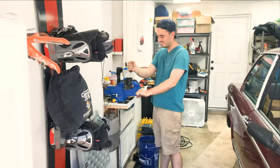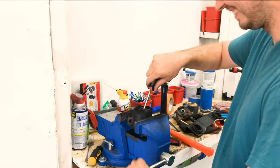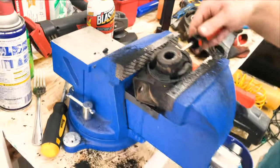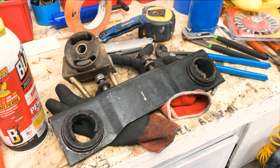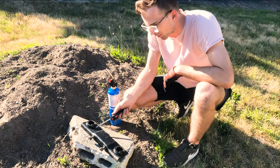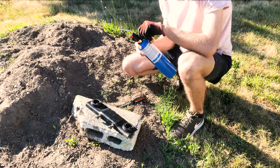It's rubber from 72. First gear, second gear, third gear — it's still probably more tight than my shifter. Let's torch it. You think torching is not going to smell bad? A little bit, but different. A portion of the bushing is out. Now we're going to try heating up the metal around it to see if it'll separate from the inner bushing portion. Torch it up — finally. I told you we'd use it.